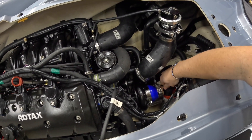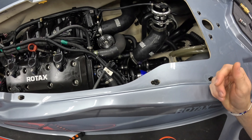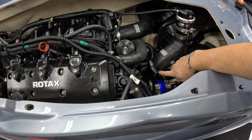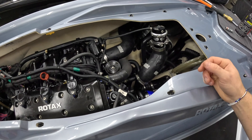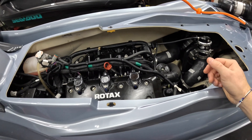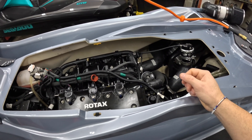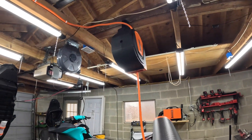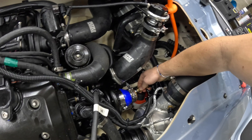Now that the tester's clamped on there, you want to clamp it fairly tight, because when you pump it up with air the last thing you want is for it to pop off. What this test is going to find is any leaks at all. Most common on supercharged engines, your hose clamps are going to be loose — Sea-Doo is famous for not tightening clamps down enough. You can also use a bottle of soapy water: if you hear a hiss but aren't sure where it's coming from, spray soapy water everywhere and wherever it bubbles, that's your leak. Now we'll connect the air source.